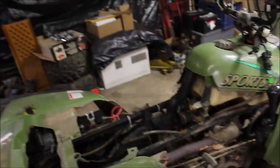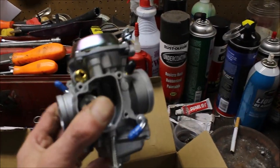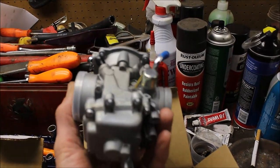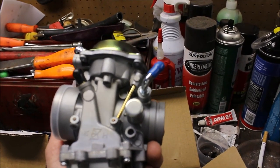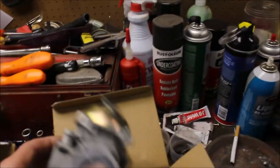So I ordered myself a bunch of goodies, and here's my quick tip of the day: to bypass all that guesswork, go buy yourself a cheap $37 carburetor off eBay and throw that bad boy in. Now these carburetors aren't the greatest — it's an aftermarket carb and from what I hear they only last a year or so before issues happen. But I don't know — $37 bucks. I'd rather throw away $37 and try it out to see if it clears up the issue than spend four hours trying to figure it out. So that's number one. Number two: I got a fuel pump.